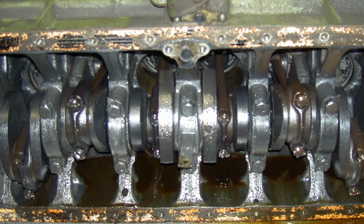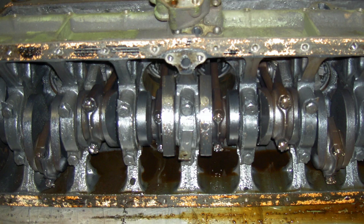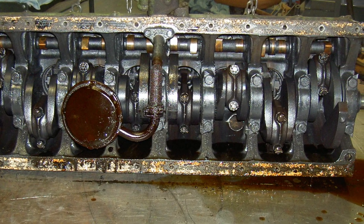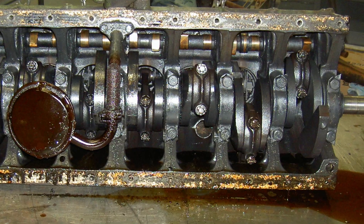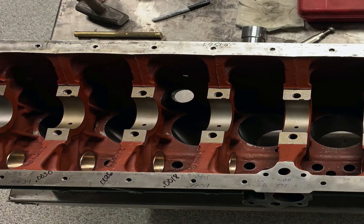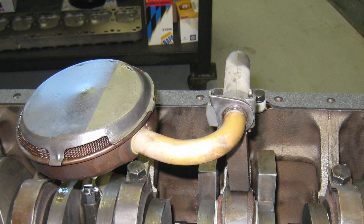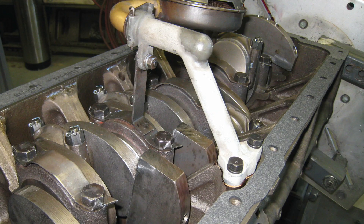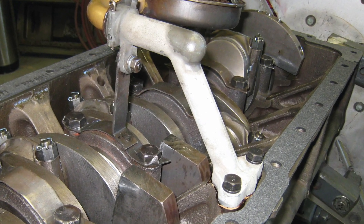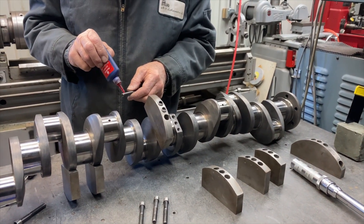Diving into the engine directly, we've got a nine main bearing engine, which is pretty typical for Packard — all the Super 8s and everything were nine main bearing. When you get the crank out of them they tend to be a wet noodle, so it really needed all those nine main bearings for support. A few little cheesy things they did — like the oil pickup was pot metal, not the greatest idea, but they were trying to economize. All in all, underneath the crankshaft it was really a great design.